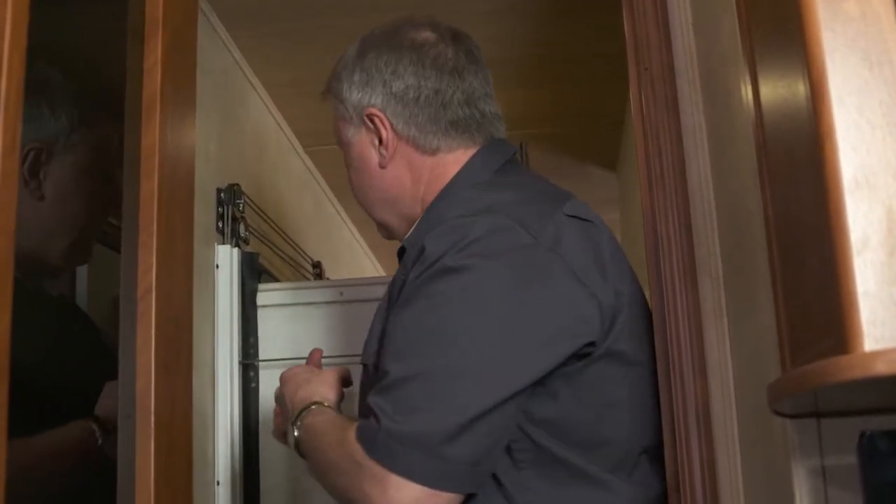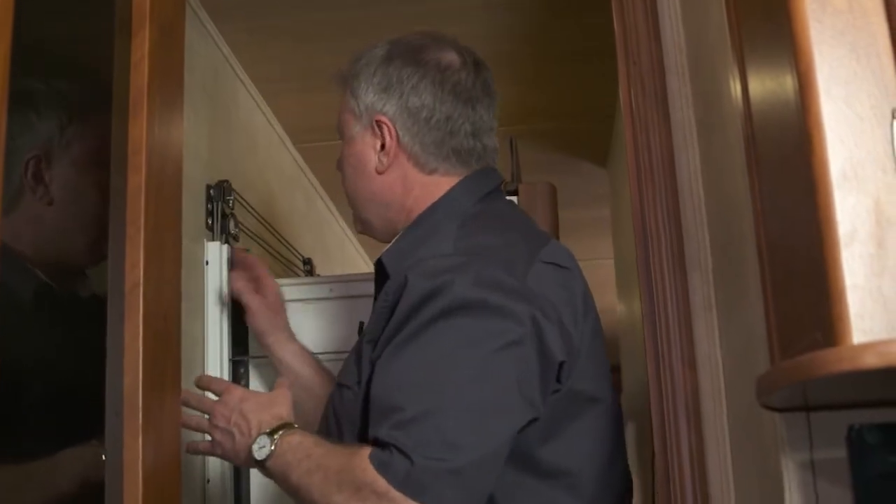We're going to take this jam off. We've got the room completely extended so we've got the pressure off of this. If we had it halfway through we'd have pressure and we'd have to figure out a way to get it back — that may mean taking the cables out. But we're going to take this jam off first and show you those pulleys.